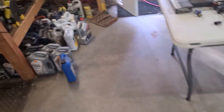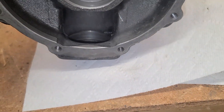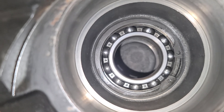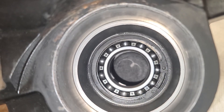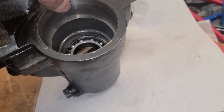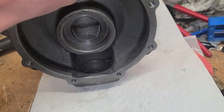Once that comes off, the whole thing drops down and you end up with this. I have cleaned this apart. The other one I'm not going to take apart like this, but I really wanted to see what it looked like inside. You'll have a bearing that goes in there. I've taken everything out except for this one bearing — it's a simple snap ring and then the bearing comes out — but I decided to not take that one out. I sprayed everything with brake parts cleaner and then wiped it down. There was still quite a bit of gunk in there, and a lot of dirt had gotten through the seal, and I had some rust at the top that I cleaned up with a bit of sandpaper.